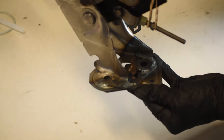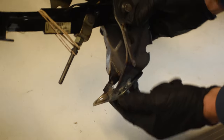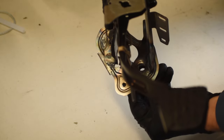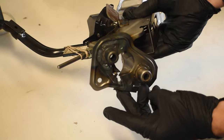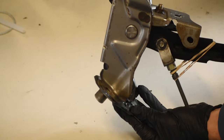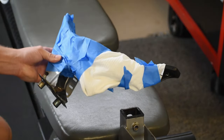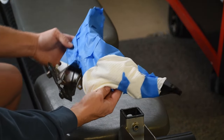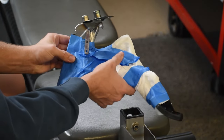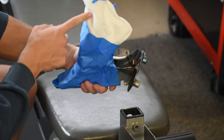This is not essential or even relevant to stopping clutch pedal squeak, but I figured while I had it out, this was something that should have been done. Anytime that you weld anything, you're always going to want to paint it to make sure your welds don't rust and that they hold up as well as possible over time. So with the pedal all welded up, I taped it up with some paper towels and painter's tape to go ahead and spray paint the areas where I welded it.